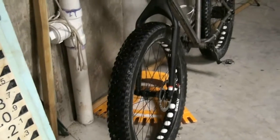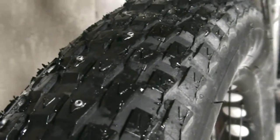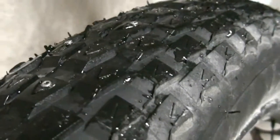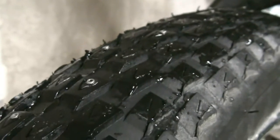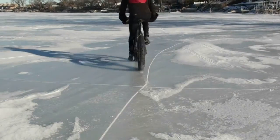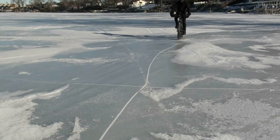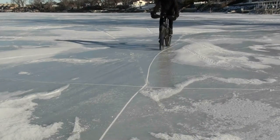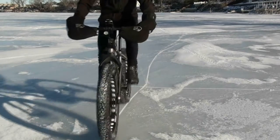We've been riding nine miles on cement, and we'll see what kind of wear we've got on these. You can see they've kind of rounded off on the edges, but they've still got some decent depth and they still work. Those first studs were installed without glue, and I lost about 5% of them on an 18-mile bike trip on city streets. I failed to notice there was a section where several in a row dropped out, and that's why I slipped at the end.